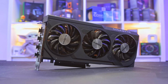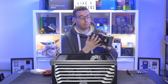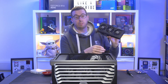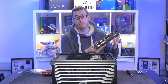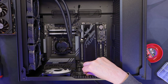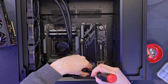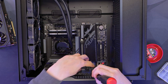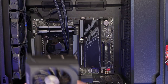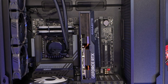Now let's install the graphics card. I'm using the Gigabyte GeForce RTX 4070 Super — one of their more entry-level cards but certainly good price-to-performance. The construction does feel a little bit plasticky, to be perfectly honest, but I will have a full review for a deeper dive. It could be a good option if you're on a budget. I remove the slot cover, undo the top two PCIe bracket screws — noting that this case has an extra thumb screw to access them — and slot the card in.